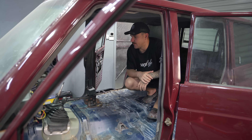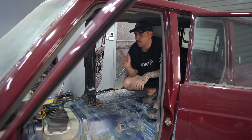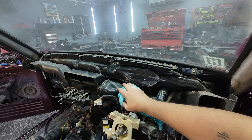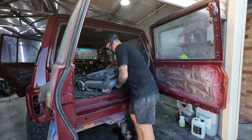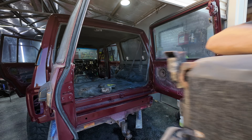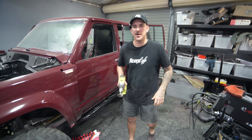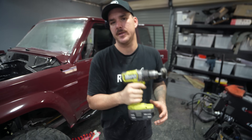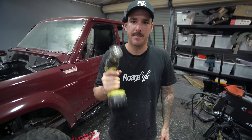First we need to fix the inside of the car. It's actually looking really good in here after a nice vacuum. I've also gone ahead and wiped down what's left of the dash and vacuumed that out as well — lots of cobwebs. Taking the very back seat out as well and the carpet just so I could check out the floor. It's actually not too bad so we are going to be making this floor look a lot better. I forgot to buy a wire wheel for the grinder so I'm left with the drill and this tiny little wire wheel, and I'm going to be using that on all the rusty areas. Then we can go ahead and paint — the paint I've got is designed to be used through a Schutz gun but I'm just going to be painting it on with a paintbrush.